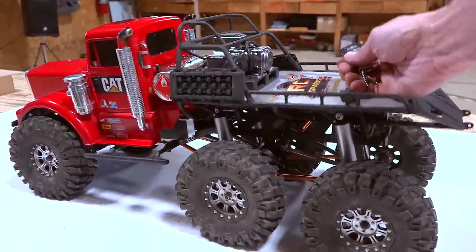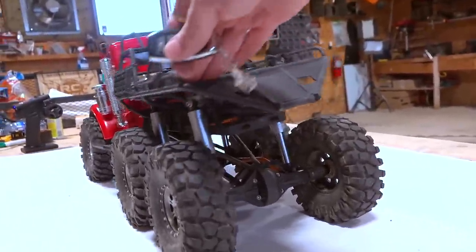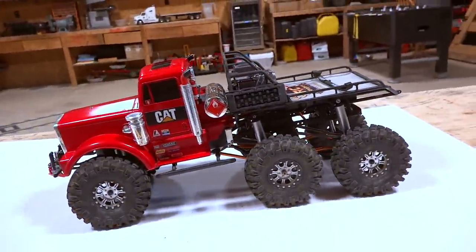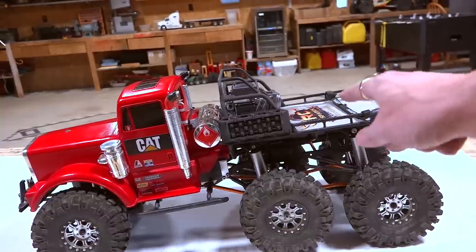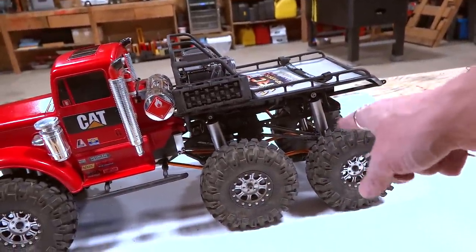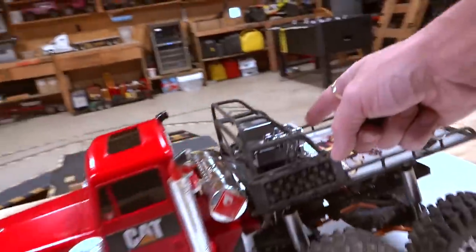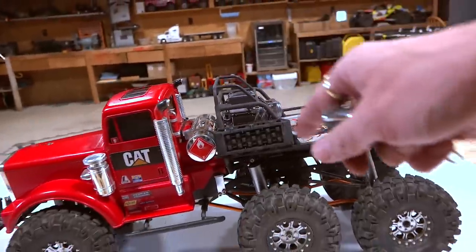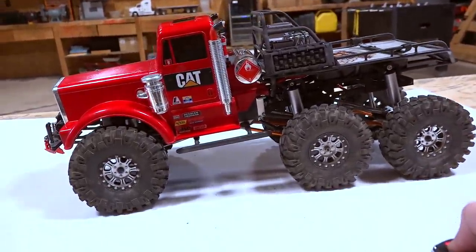And so if I push on it now, lots of stiffness, but it still has plenty of spring to it. One thing I noticed though, and they probably didn't think of this because it's made over where it doesn't snow. A cold day like today, minus 25, you take this out for like 2 or 3 minutes and your suspension will actually lose its air because the cold is compressing everything and it will get a leak. It might even be in the valve. Now that I'm saying that, I think it's probably up in the valve here. So be aware of that. This is more like a spring, summertime slash indoor kind of ride.